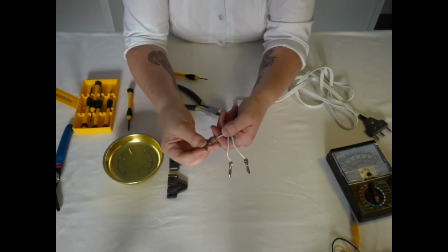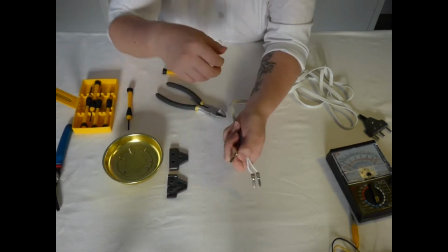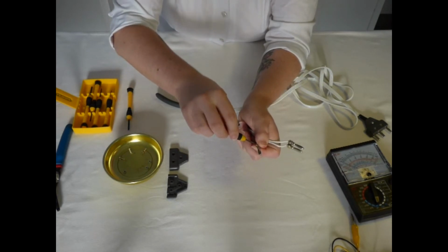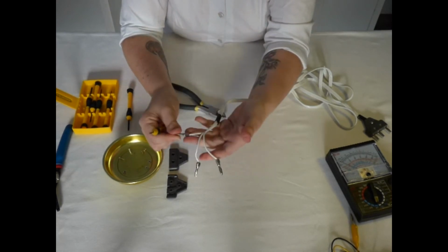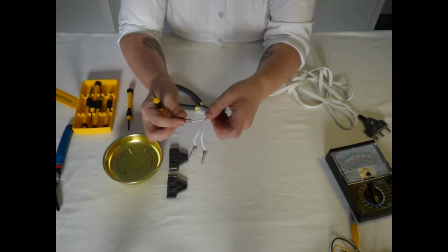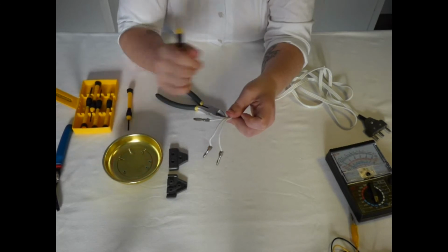Slide the prepared wire back into the prong. You'll see it fits quite nicely inside. And tighten the retaining screw back down. Make sure this is snug and is actually just this mechanical contact that forms the electrical connection and holds the prong in place. To make sure everything is solid, I like to give a gentle tug on the prong and the wire. Nothing should move.